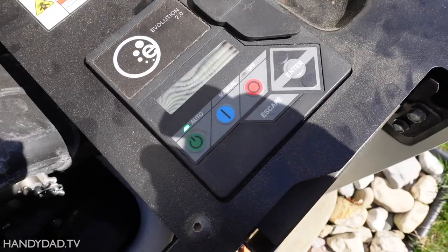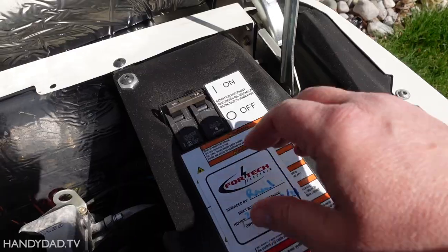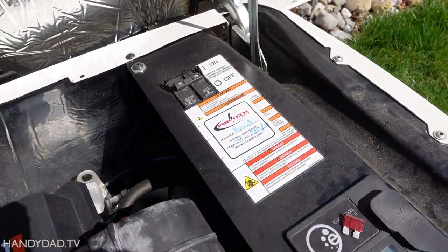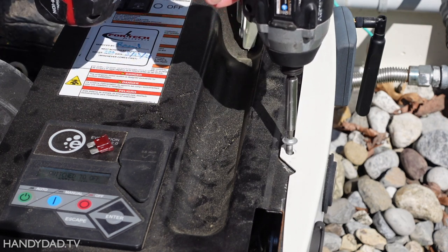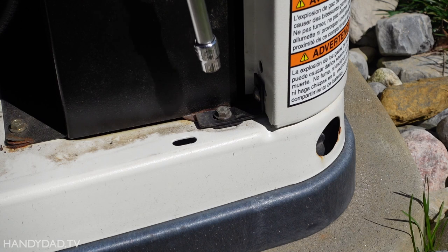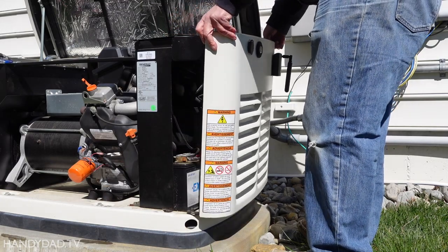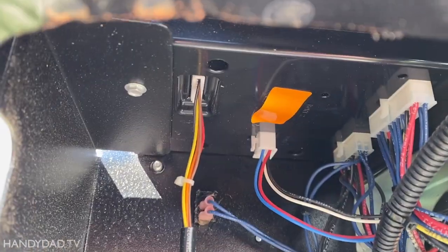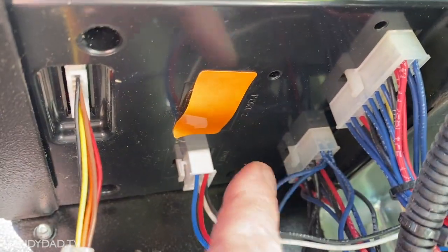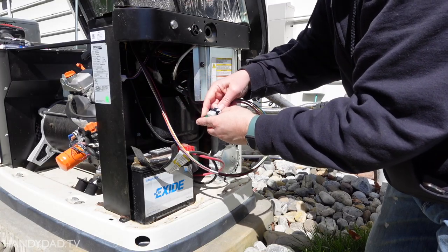After opening the generator, I turned it from auto to off so that it wouldn't start while I was working, and I also removed the fuse and turned off the circuit breaker for good measure. I used a 5/32 inch hex bit to remove the two screws from the top of the battery compartment, and a 10 millimeter socket for the bolt at the bottom. With the side panel removed, I located the Molex connector under the generator's controller. I unplugged the built-in WiFi module that was plugged in there and plugged in my Molex cable. Then I plugged in the Pi and let it boot.